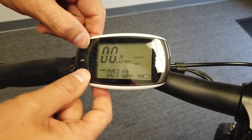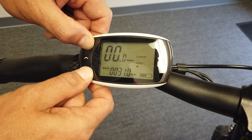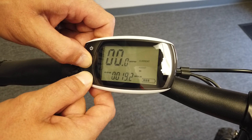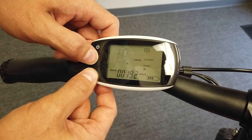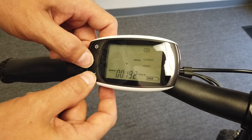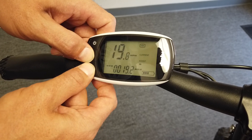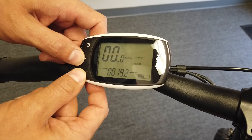The power and down menu changes between miles and kilometers. Then up and down allows you to change your tire diameter — if you use a smaller street tire, you can lower the diameter slightly. This is not the actual diameter of the tire, just different settings that slightly reduce the size so you get the accurate speed. And that's it.